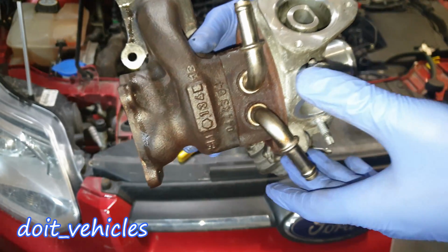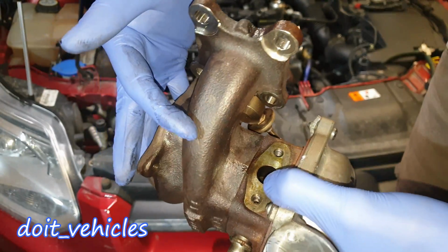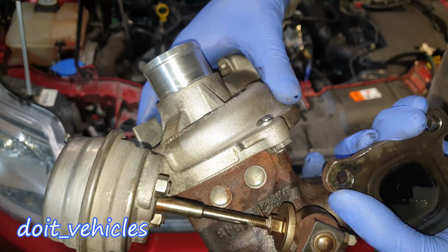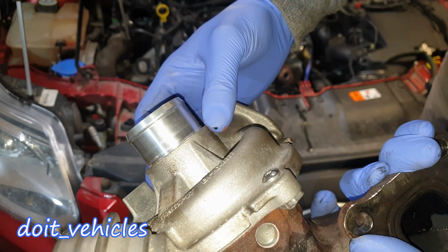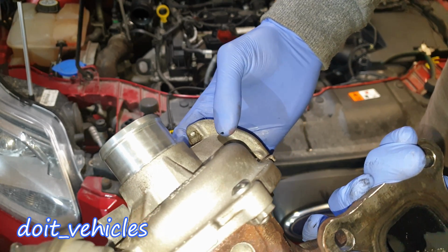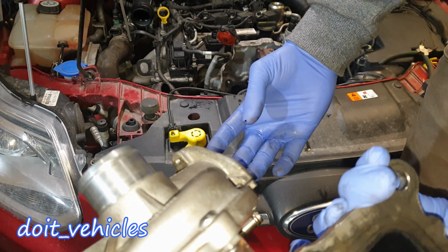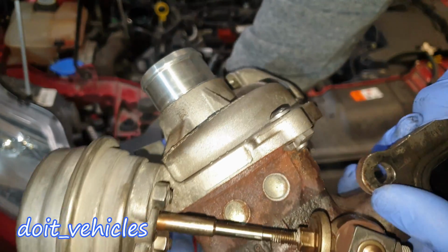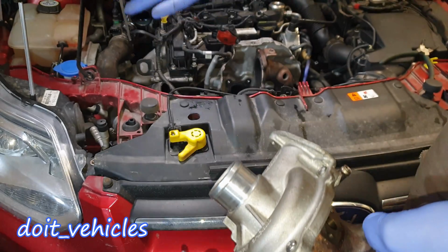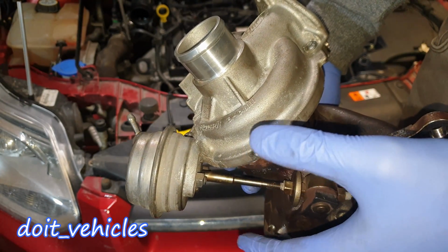So that's the point where the turbocharger comes in. It will take those exhaust gases, they will travel through this pipe, and spin that turbine, which is connected to the cold side of the turbocharger, which basically will take the air from the outside and pressurize it. Therefore you've got basically a small vacuum cleaner which takes air from the outside and pushes it with a lot more force into the engine, and therefore you're going to achieve more power more quickly compared to a naturally aspirated engine. Obviously, the bigger the turbo, the more air you can pump into the engine.